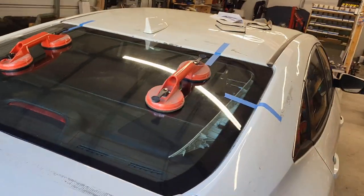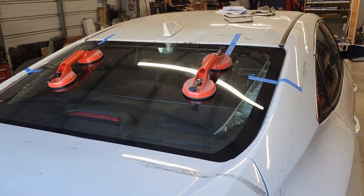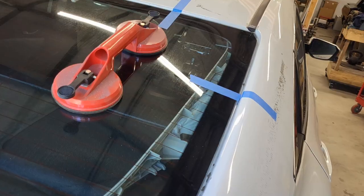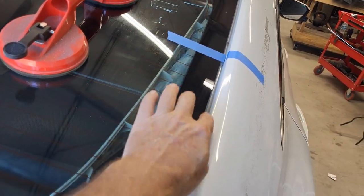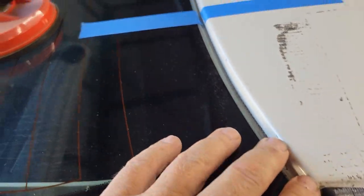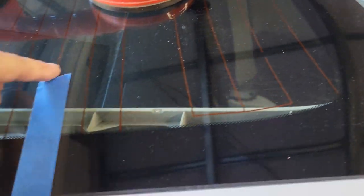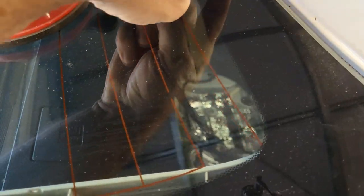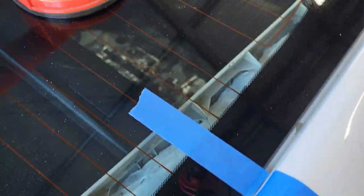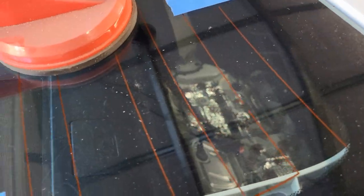So there's a look at the window in place with a dry fit — no sealant. We just want to make sure we have everything lined up and our gaps are where we want them. Everything looks really good, gaps look good, and then we just use some tape so when we come back in with it for the final fit — these are all cut now — if we line up our tape marks our window will be exactly where we want it.